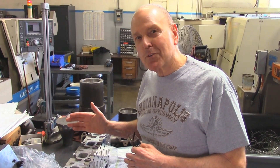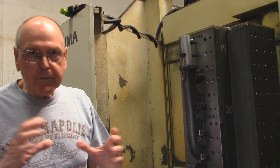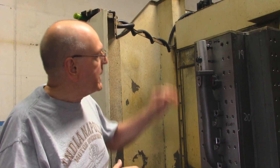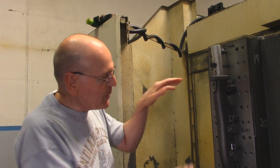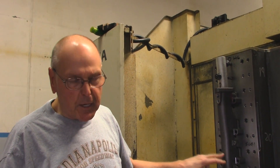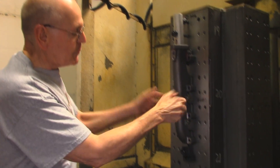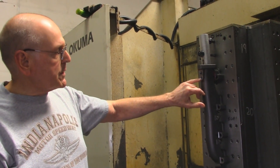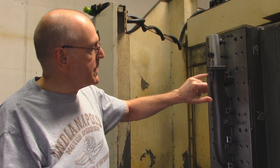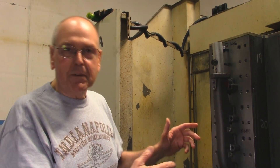Let's go look at a few other things here. This is a Friday and I'm kind of checking out where things are at Banks. What we're doing is two different outlet sizes, both of them will be CNC'd. Our outlet plane is precision aligned as well, similar to the way we're making the head and the manifold aligned with each other. This is a heat shield mount right here, and we have a heat shield that shields the steering gear on your street-driven pickup truck. We've got a drive pressure or turbine inlet pressure fitting and a thermocouple fitting on both banks, so you can look at how each bank is running and pick out any injection issues bank to bank.